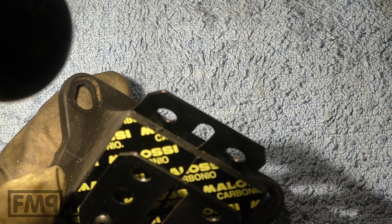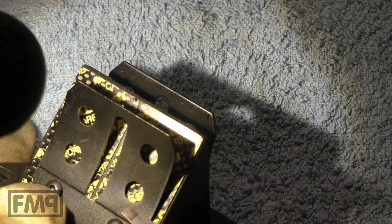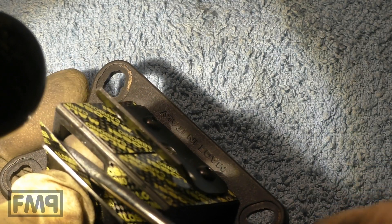There is rubber below and they really tighten up. With damaged reeds you also have blowback problems and you cannot set the carburetor — blowback even though there is no intake timing, because reed valves don't have intake timing; the crank does not close the intake anymore. This metal thing keeps the reeds — don't remove it — because it helps the reeds not to bend too much. It limits them; if it's not there they bend even more and the edges get damaged.